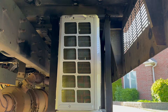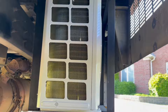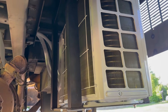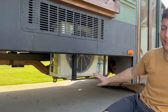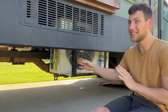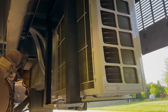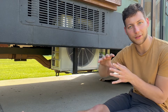The first thing I had to do after removing the old AC unit was build the bracket to mount the outdoor unit to the underside of the bus. I welded up this bracket which is pretty much just angle iron surrounding it. It does hang a little low but it's still higher than the stairs and a lot higher than the exhaust system. This was probably one of the hardest parts of the install just because we had to weld the bracket up to the bus — it's kind of a pain, but once that was done everything else was a lot easier.